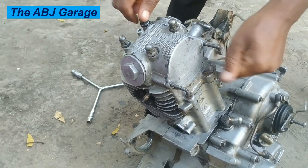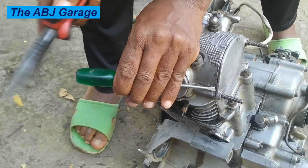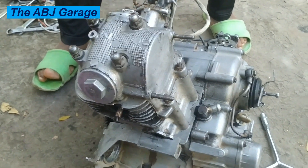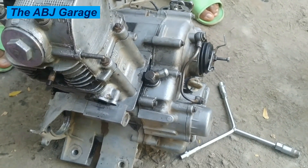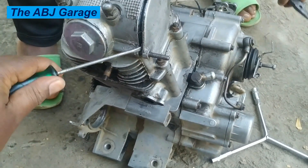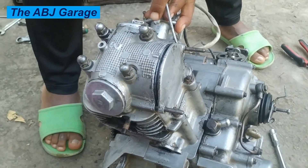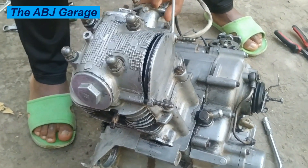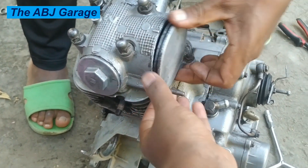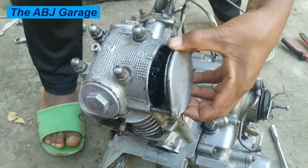As you can see, there is a valve chain cover on the right side. We are going to remove that and remove the timing chain. These engines are timed by a chain connected to the crankshaft — it's a long chain with two-sided tensioners connected to the camshaft sprocket. By removing this cover we will remove the chain, and then those four heavy bolts are for the cylinder head. On the chain cover side there are also two 10-millimeter bolts.